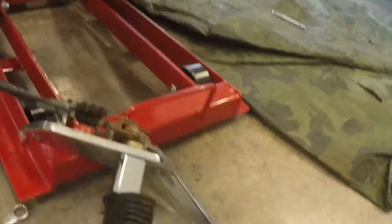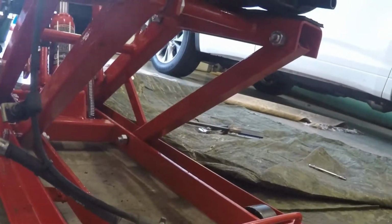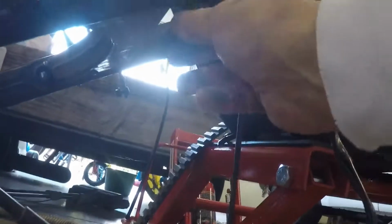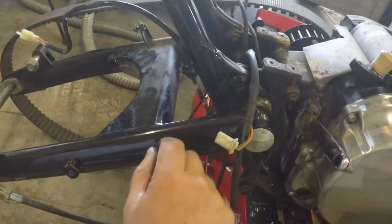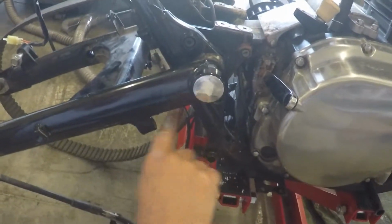We're taking the brake off. We took it off of here, and these brackets held it here, and this cable ran back to the actual brake, and we lifted it off of this right here. There's a little slit right here we took it off of. But then it has an electronic thing here that, when you push on the brake, has to run the brake light. So this is spring actuated. We're going to take the spring off up here and disconnect it from the electrical, and then I can take the electrical off the other end. Make sense? So we're going to take this loose here and here.